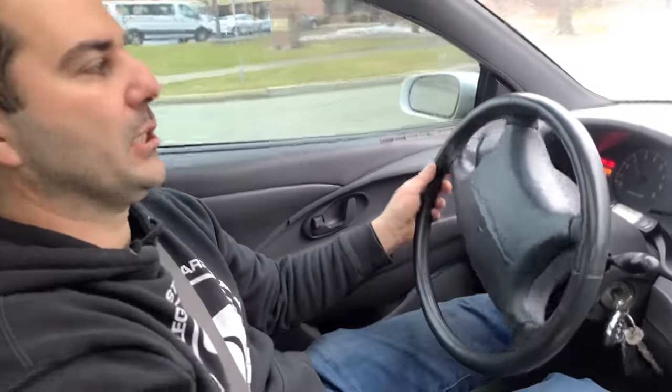Basically we unloaded the right side of the vehicle and the noise goes away. It's very obvious in the car. So that would point to a right side wheel bearing. And I also think it's coming from the rear as well. Yeah, she's loud. In the first video on this car, we already swapped all the wheels and tires. It has like 20-year-old tires, but that made no difference at all. So we're obviously gonna get new tires, but I think we have to start off with a wheel bearing. Let's go back to the shop and see if that's our smoking gun.